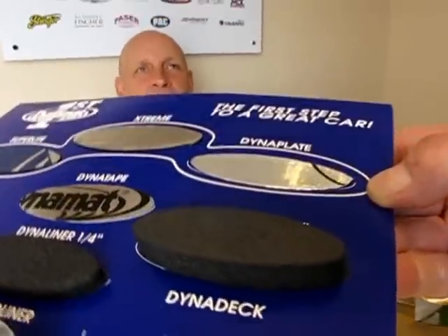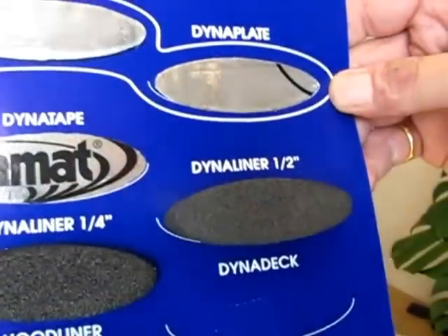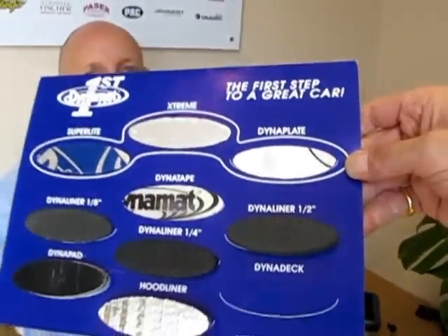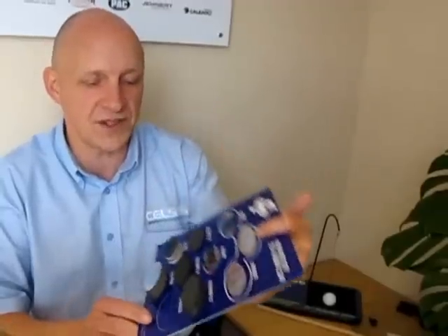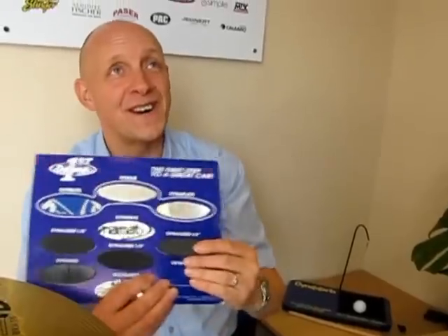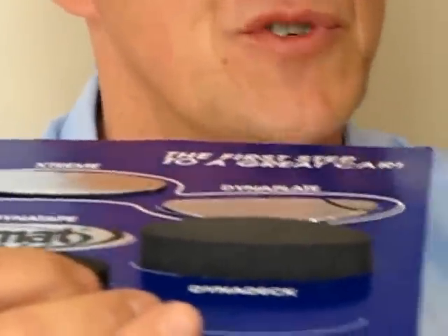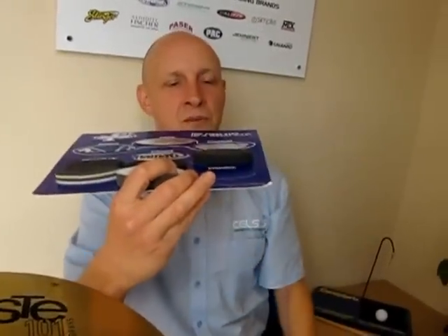We all understand double glazing in a home — double glazing is an air entrapment device. It prevents noise from outside the house coming in, and it prevents the cold coming in or keeps the house cooler in summer. This, effectively, is double glazing for your car. You've got millions of tiny little air bubbles in closed-cell foam. It's not like a normal foam — it's not a sponge. It doesn't absorb water and it doesn't absorb oil, which you simply couldn't have in an automotive environment.